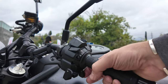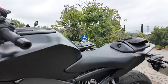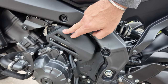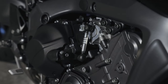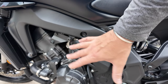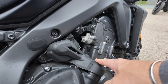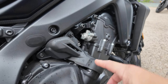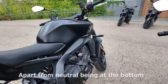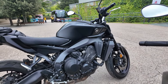Here are the flappy paddles on the left-hand switchgear. First thing you notice: there's no clutch lever, and of course there is no gear lever either. You've basically got a motor underneath this cover actuating the gear input shaft, and it still retains the quickshifter. On the other side, under another cover, you've got another motor actuating the clutch. The actual internals of the engine and gearbox are unchanged — just two motors actuating the gear lever and the clutch rather than you.